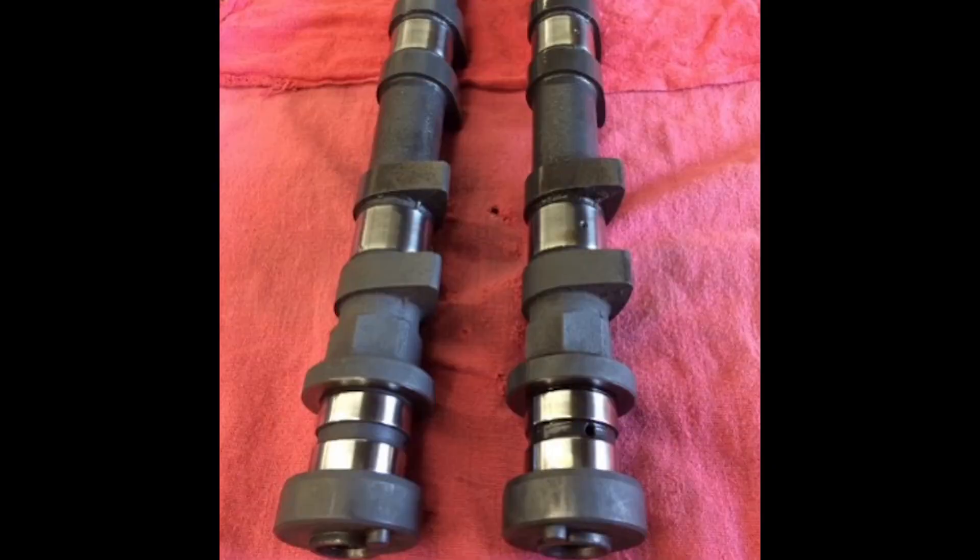So on to the spec list for this motor. We're going to start from the valve cover and go all the way down to the oil pan, then the drivetrain, then the suspension. So you pop the valve cover — this motor is actually a 1995 KA, so it's out of an S14. The stock cams have been ground to a 274-274 profile. They're high lift, high duration, so they're pretty aggressive. Once this thing is running, it's probably going to sound like a mild-built 2JZ.